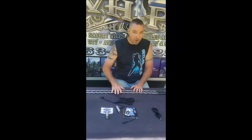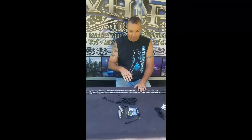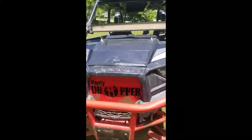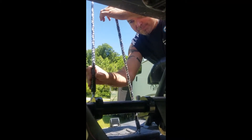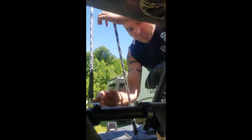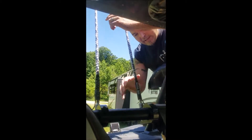What I want to quickly show you is a real quick installation on the Outlaw Whips razor here — it's not detailed at all, just showing how the plugs plug in and the sequence of the components. The springs are already installed on the bike. The tools you will need for our installation is generally going to be a 9/16 or half inch wrench. You'll see that our whips screw into the spring mounts, and that's where you'll need the wrenches to tighten the spring bolt and also the whip into the spring. These do not have the whip quick disconnects, but we will do another video showing how those operate and assemble together.